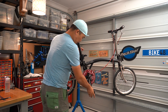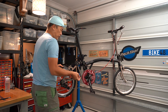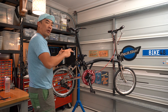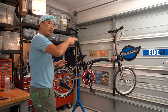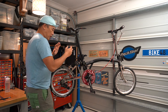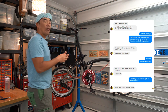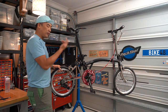So I'm going to drop the chain and remove the crank and check if the BB is okay. It's quite hard to check when it's under no stress, but if it's really broken you can spin it with your finger and feel if the bearings are gone. I'm going to remove the crank and check if the bearings are still smooth. Also, earlier today someone was asking me if he needs a washer — a spacer — before he installs the BB, so I think I can cover that here as well. Let me remove the crank now.